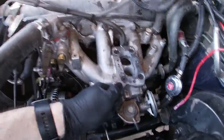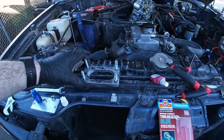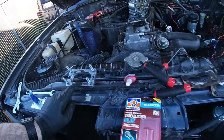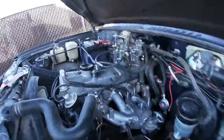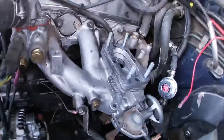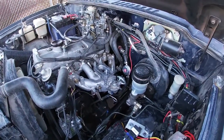The bottom plate nice and stiff this time. I got the next plate prepared with the mounting bolts Loctited in ahead of time. Now I just need to mount this using the gasket here to there, and we'll get it going. Alright, second plate's on. Giving it a few moments here, just wiped around the excess where I was sealing it with some goop. And I'm gonna get the actual carburetor mounted here in a moment.